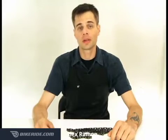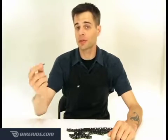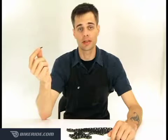In this tutorial, we'll learn how to remove and install a connecting pin on Shimano HG or IG chains. These types of chains require a special replacement pin that has larger peens.